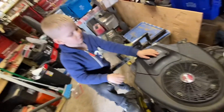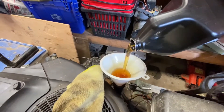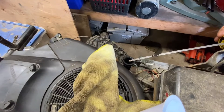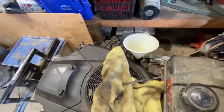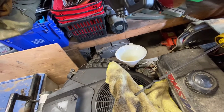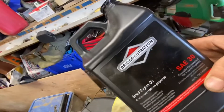I can't see if there's any oil in there — too dark. It looks like a lot but that's a super small funnel. These V-twins take a bit of oil — apparently the whole 48-ounce container. This thing hasn't even been started yet, so the filter's not even completely full. I might have to run to the parts store and get some straight 30.